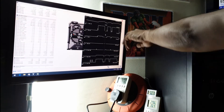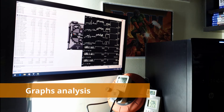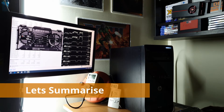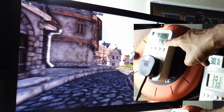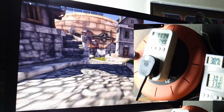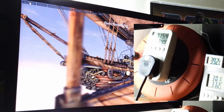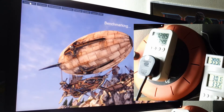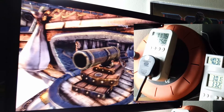Everything is maxed out, fully used, but the temperature and power are stable — which is what our build is all about. In the last 10 minutes I've shown a lot of things that happened in a very short time, but actually these things happened over 3 to 4 hours or even more. The downloads alone were worth 500 GB of data. The basic stability test using the heavy load software alone took more than 2 hours. Then we did the durability test — we repeated the Aida64, Crystal Disk Mark, and Unigine Heaven tests 3 times to make sure performances were consistent.